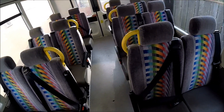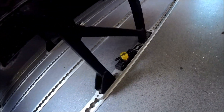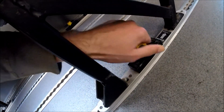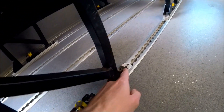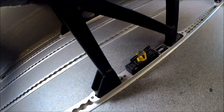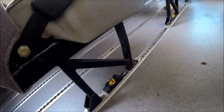First things first, get all of the Unwin quick release mechanisms unbolted and removed. They're relatively straightforward — they're called quick release for a reason. You just need to twist the lower bit round, which is in the locked position, flip it round into the unlocked position, lift the lever, and turn that round as well. Do exactly the same on the other one. Then just with a little chock of wood, knock the seat back so it fits into one of the round holes, and the seat itself just lifts straight out.